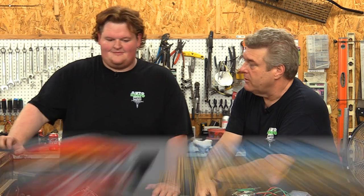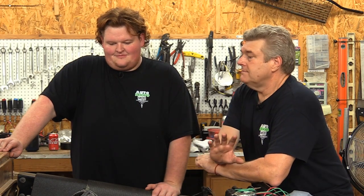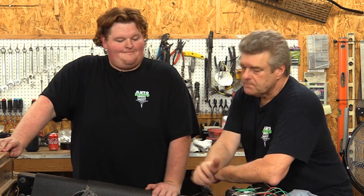I mean, I mucked around with this thing for a while. This is not just a last 15 minutes thing, because it acts just exactly like a blown power valve. A blown power valve. And as soon as you get it on primaries, it misfires and carries on. Yeah, exactly. You take it off the idle circuit and then it just goes nuts. But I figured out what it is.